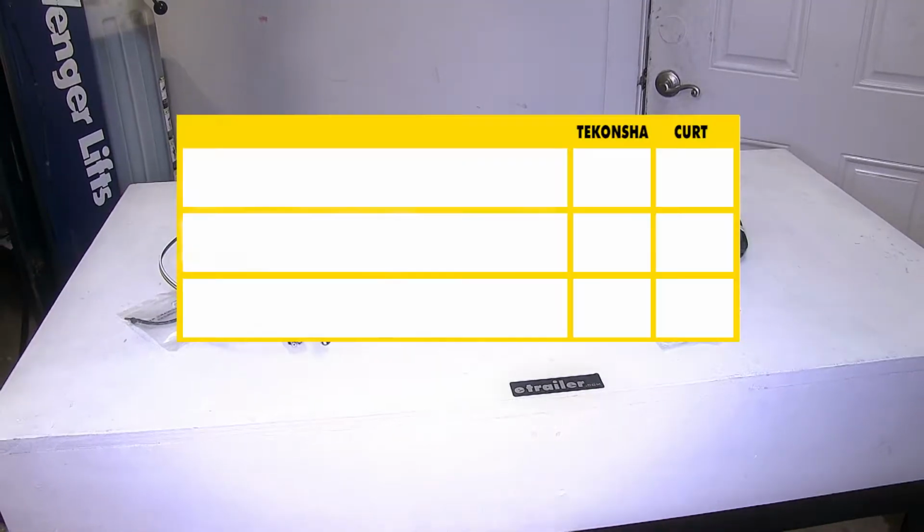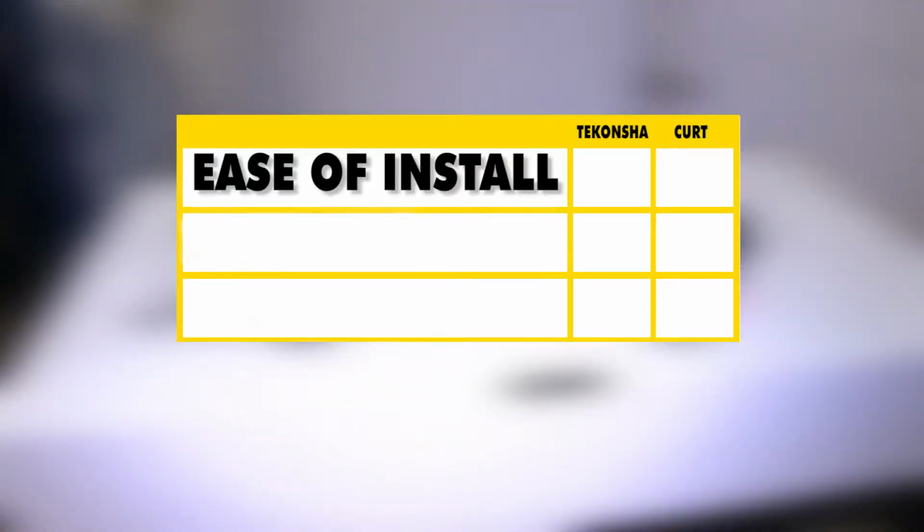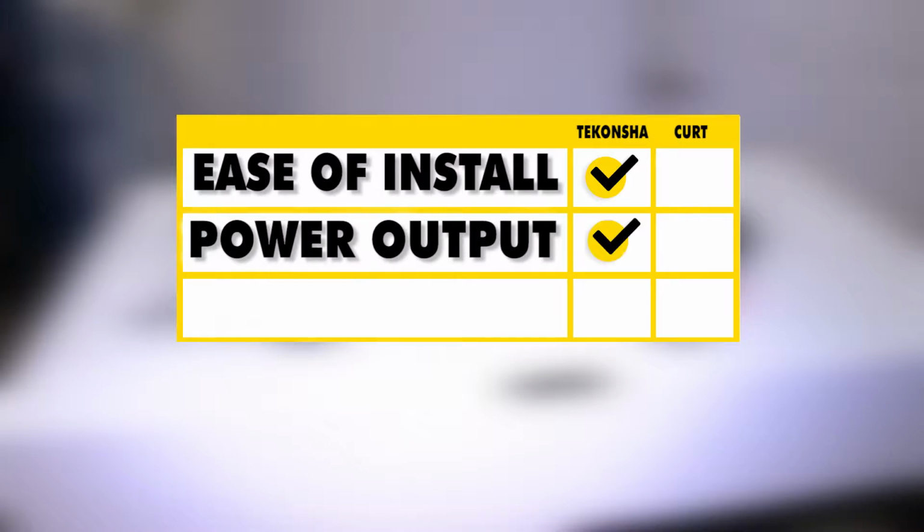Now for a brief summary. As far as ease of install goes, the Tekonsha is the clear winner here because we don't have to run a power wire up to our battery. As far as power output goes, they're both about equal because one's higher on the tail light circuit and the other one is higher on the turn signal and stoplight circuits.